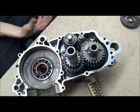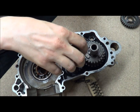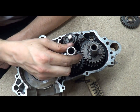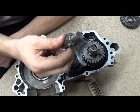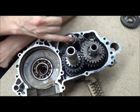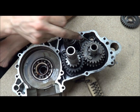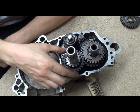Even if you know how it works it's hard to see as it's actually happening, but basically all it does is it just moves one fork, one gear in to engage that one, moves right to engage another gear. What I'll try and do is slot this third one in just to give you a proper demonstration of how the gear should work, and you'll be able to see the rotation change. The reason you'll see the rotation change is because this gear is locked to the shaft.